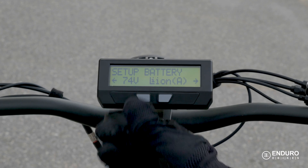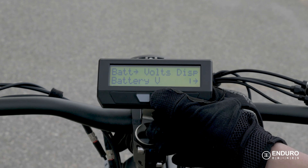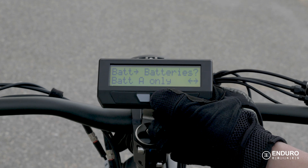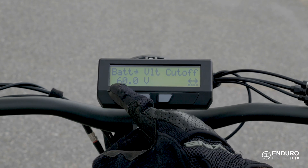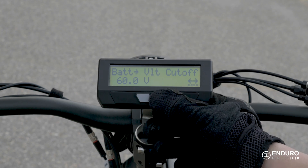Something else that gets me amped up is the low-voltage cutoff feature of the Cycle Analyst display. While lithium batteries have a battery monitoring system to prevent over-discharge, the experience for the rider is an abrupt loss of power with no warning. Setting the low-voltage cutoff 1 to 2 volts higher than the BMS shutoff voltage will result in a gradual reduction in power instead, with the added benefit that you'll get more amp hours and range out of the battery too.